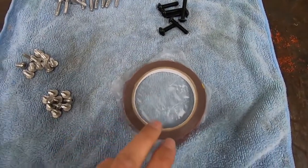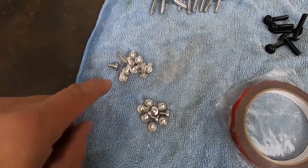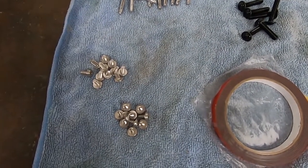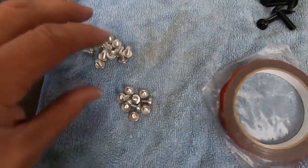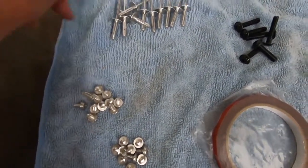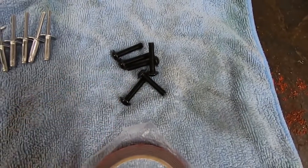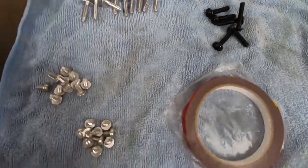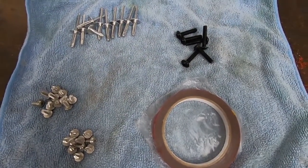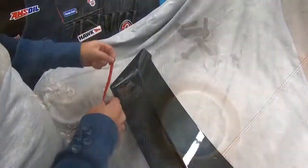Here's the hardware the kit comes with: it comes with sticky tape that we'll use to mount the very front of the splitter to the front of the bumper. It also comes with all the machine screws you're going to need. If your car is equipped with a factory skid protector on the bottom, there are screws for that — my car isn't, so we won't be using those — but the holes are already drilled. We will be using the rivets as well as the attachment screws for the side winglets. It's a very simple installation.